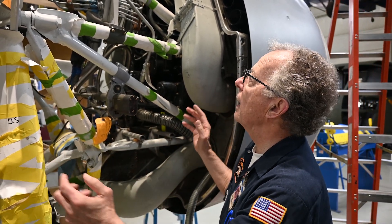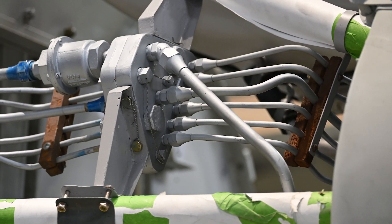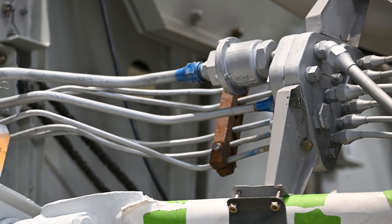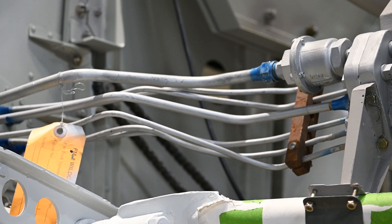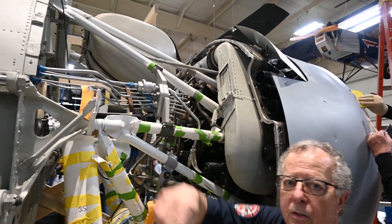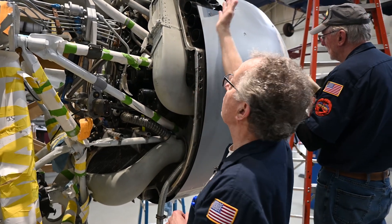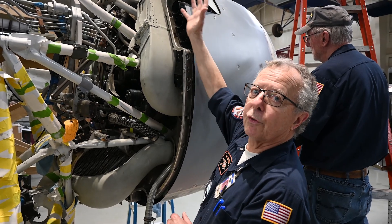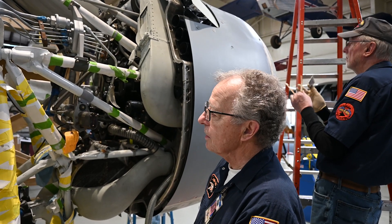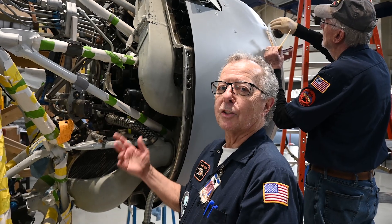Our focus right now is to get all of this hooked up — these lines, a lot of them are vacuum lines and other instrumentation lines. So it's coming along but it is really labor-intensive. They got the cowl flaps here — got them installed and working. You can see the actuating rod there and there's a little crank inside the cockpit for the cowl flaps to go up and go down. In flight they're down, but on the ground they would be up to allow for easier airflow around the engine to keep it cooler.